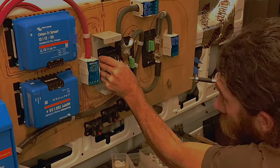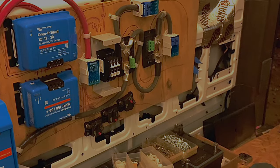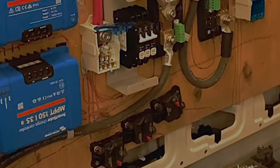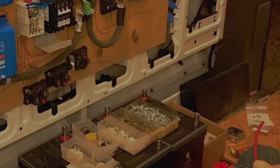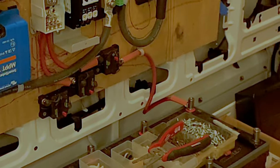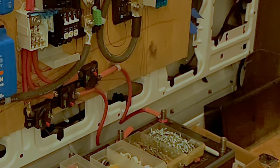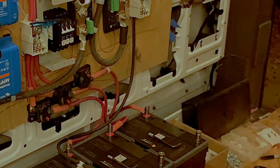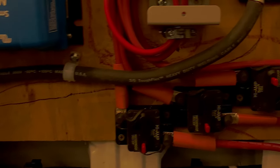Adjusting the layout so my wires have more room. Most of the wires can be any length needed, but there is one special situation to keep in mind: the positive wires from your battery to the positive junction box need to be the exact same length. This ensures that the batteries are going to charge equally. These wires pass through breakers, so I cut three equal lengths first, then cut each to the correct length from the junction box to the breaker, and then from the breaker to the positive terminal of the battery. The negative battery cables also need to be the same length as each other — not the same as the red ones, just equal to each other.